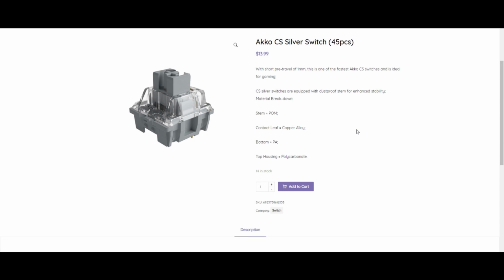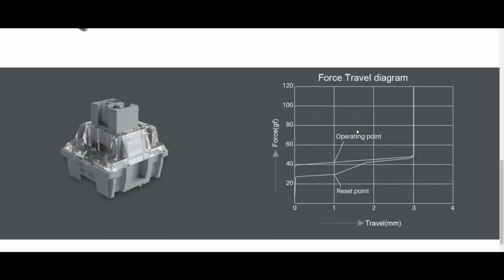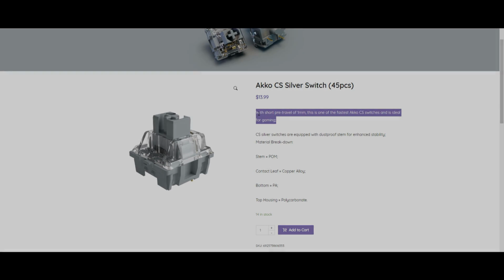It didn't feel plasticky, it didn't feel sluggish, which were my main issues when using the jelly and the CS switches on stock. I can say in terms of feel, you can actually use them on stock as well. But of course, I had to lube them, and I lubed them lightly on the stems and the rail, and I didn't lube the top housing.